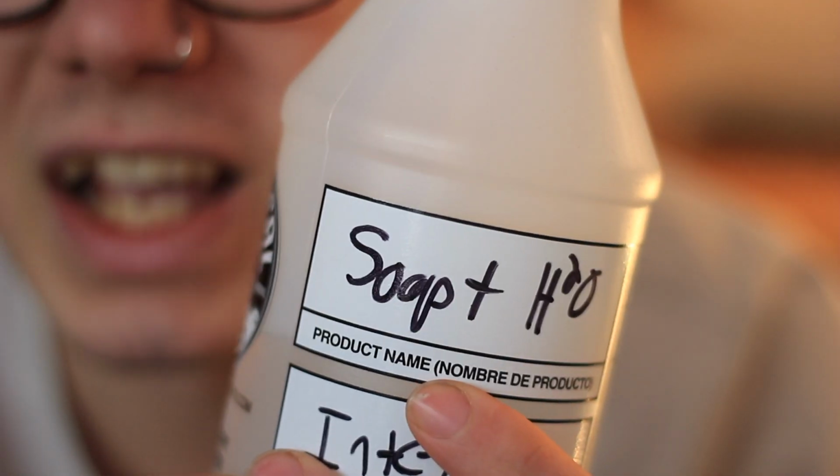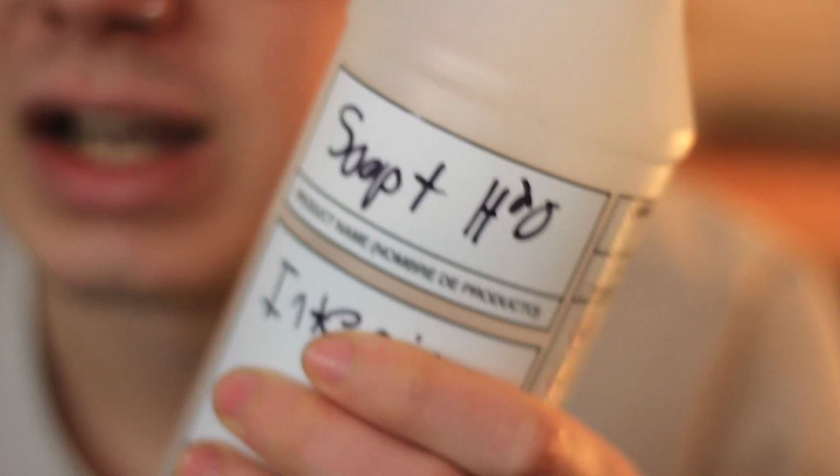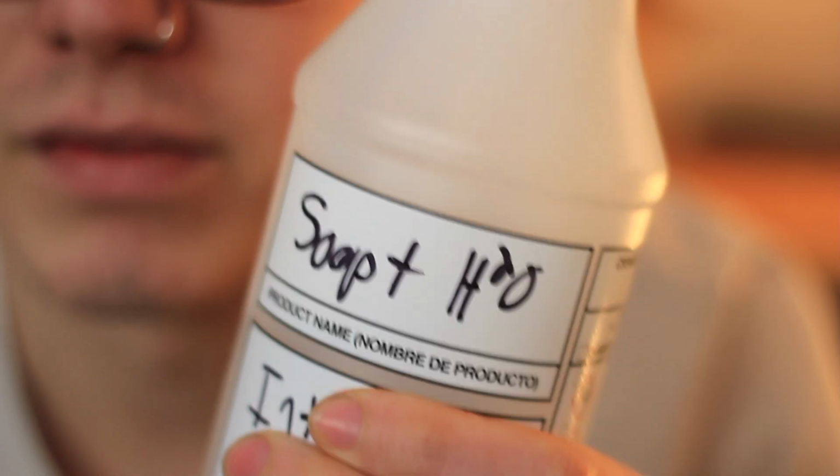Then you're going to want to use your razor blade to very gently take off the rest of the adhesive, sometimes with a lubricant, either Goo Gone, or in my case I'm going to use 15:1 very gentle hand soap and water. You guys can see it right here. You can see my messy handwriting. It's hard to tell, but it says soap and H2O. I use this in detailing just to soak messy cup holders and things like that. So this is in one of my nice bottles for detailing, but it's going to work perfectly for our purposes.